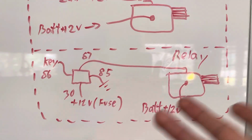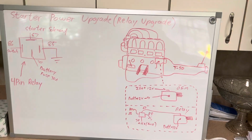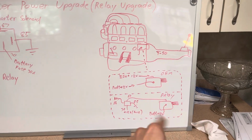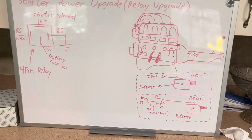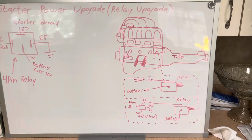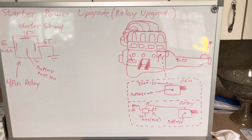And that's literally it, there's nothing else that goes into it. There's no witchcraft. There's no hidden things. It's just putting a relay in there. And realistically, all the relay is doing is clicking and giving you a clean 12 to the solenoid. Because you have clean battery power now going to the solenoid. It's a lot more powered. It's not going through a bunch of circuits until you get to that little key combination switch, turn it, and then to the starter. It's just going straight from battery to relay, which realistically is how a lot of people jumpstart these anyways. So that's it.